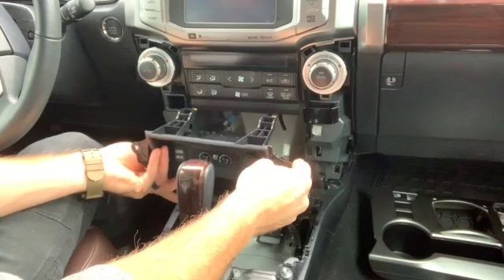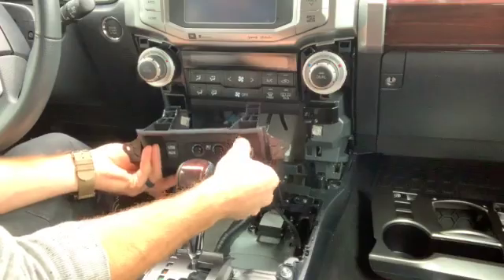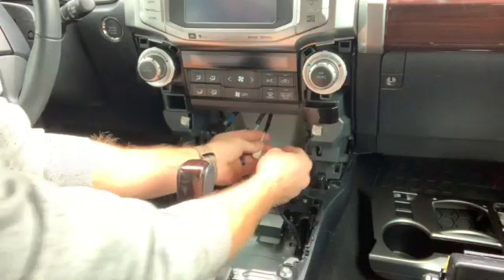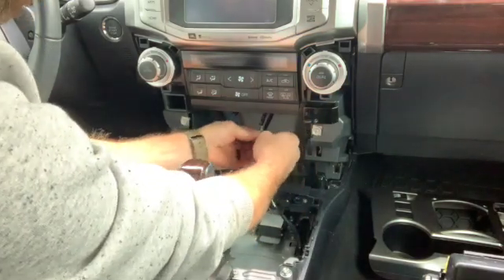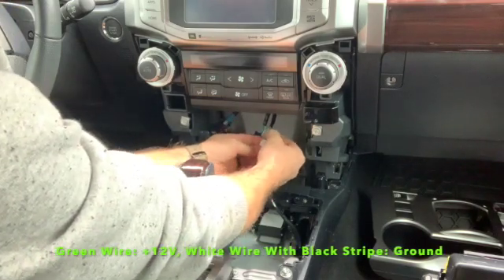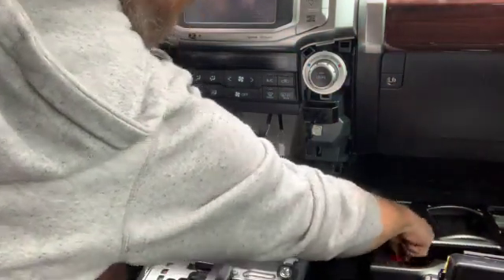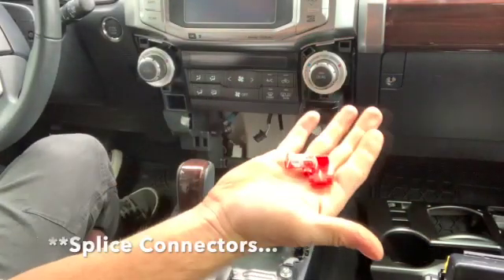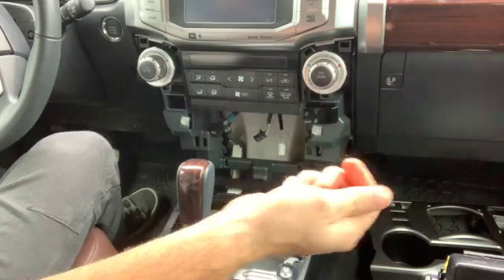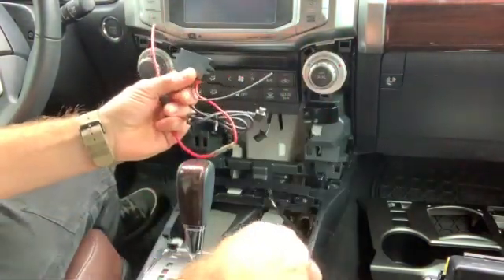On the back of my cubbyhole, the plug that I want to wire this thing up to is this guy here — this is for my 12-volt power plug. The way we're going to tie into this: green is hot or power, white with a black stripe is ground, and I'm going to be using butt connectors to tie into this. Standby, I'll get this tied into my power plug and we'll liven this thing up.